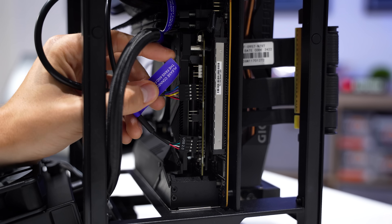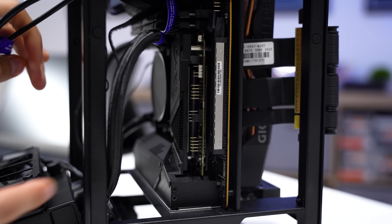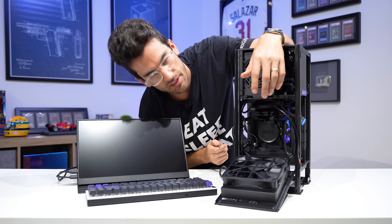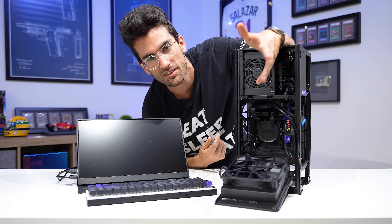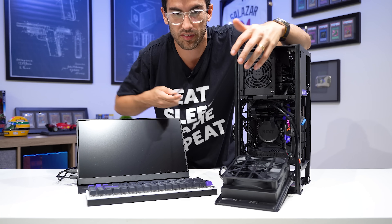What we're going to do is start by disconnecting all of these non-vital cables — so things like front panel, USB 2, USB 3, and anything else we can find. So now the only things we've still connected are the 24-pin, the 8-pin EPS, the graphics card and its supplemental power, and the DDR4. Just the vital stuff. I do have one fan attached as well, just to see if the system's on or not.